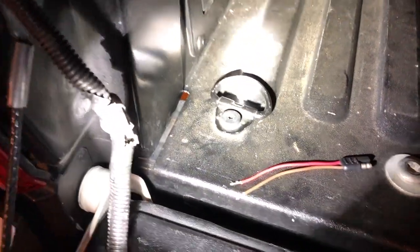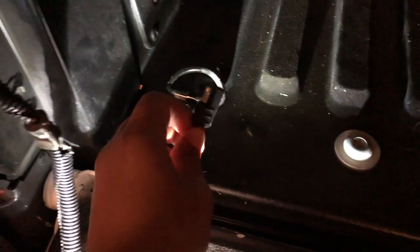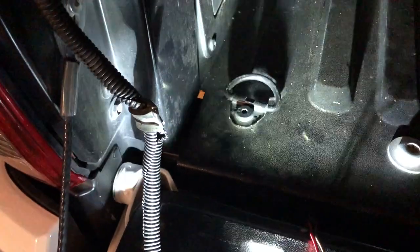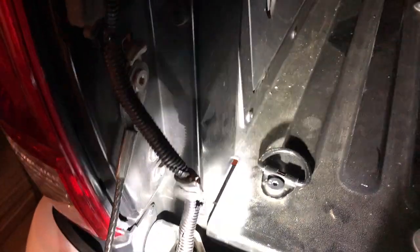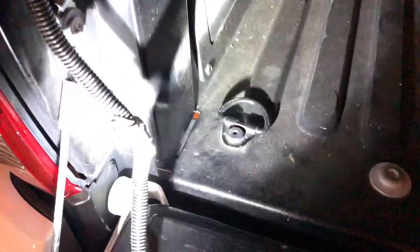Your positive is going to be tapping into the brake light of this taillight, into one of the wiring harnesses. And the second is going to be your ground — that's your black wire right there. So essentially what we're going to do is run a wire up through this hole right here, where you can see the light peeking through. That's the point at which we're going to run a wire between the taillight and into the bed. We're going to use two SAE connections and have these out here just in case we need to pop the camper off.